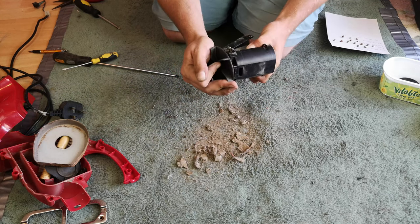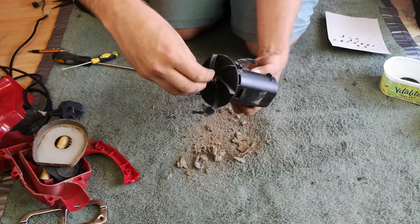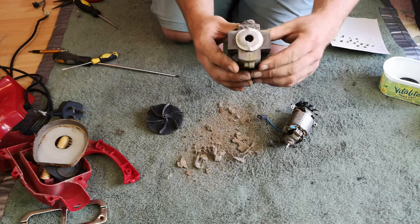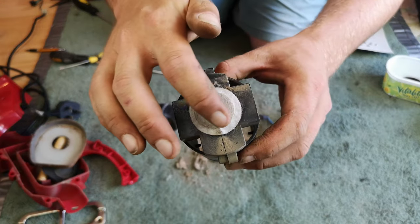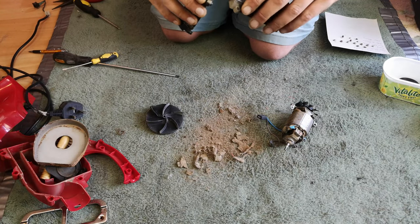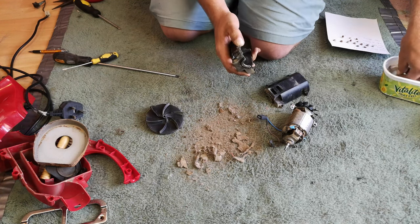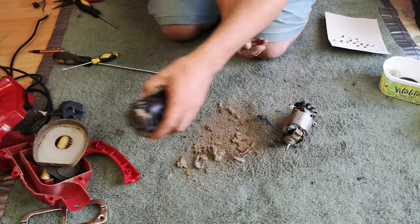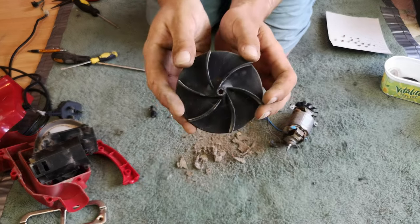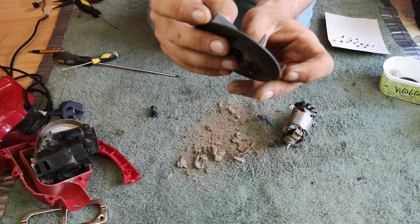We can now hold the armature inside. We'll unscrew the fan by hand and take it off. I did slightly forget about this - look at that - there is a nice felt seal on there which you have to take off. In fact, that's in such good condition I'm going to take it all off and we can just glue it back on afterwards. Now the fan will come off.